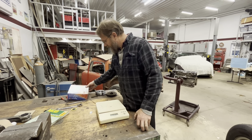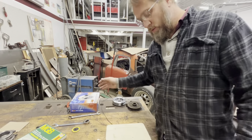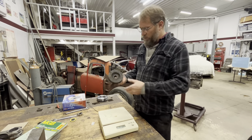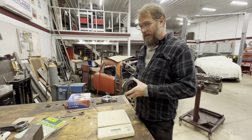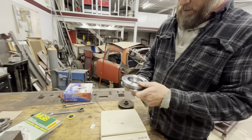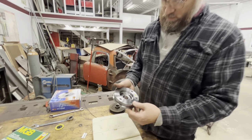One of the other things I'm doing is I got the Pro Sport damper for it, because with the problems I was having I wanted to make sure we were controlling the harmonics of the engine. I don't think my old one was doing that well - we had taken a stock one and actually had some weight removed and rebalanced it, and I don't think it was controlling the harmonics as well as it should have. These are really nice balancers - they're spin tested to over 12,000 RPM, which I hope I never hit.